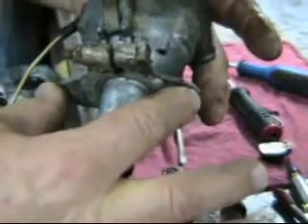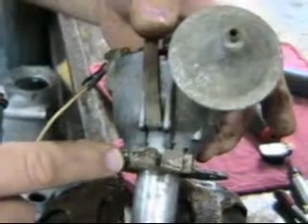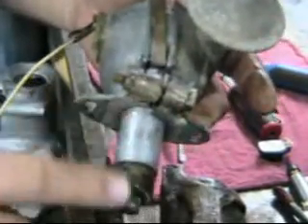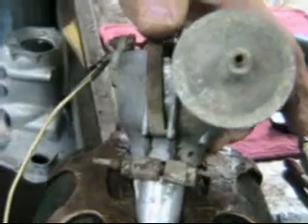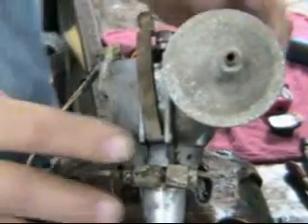This distributor was removed with the base plate, with a clamping plate like this — wrong, absolutely wrong. Don't take this off the engine. Simply loosen the bolt here and pull the distributor out. But before you put it back in, use a liberal amount of that red grease on the shank so that it will come out properly next time. Now we're going to take a quick break and I'm going to show you how to hook up the coil.